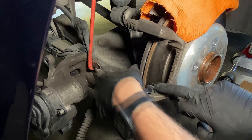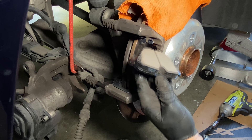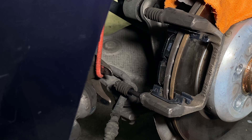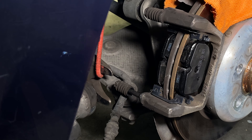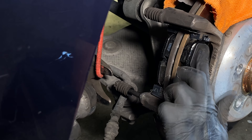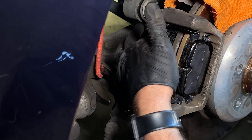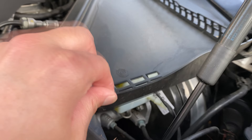I'm purposely showing you a lot of this — some people might cut it out, but I want you to be able to see how things go on and off without rushing, because the first time you do this it's just easier to watch someone else do it. There's your new brake pad — it takes a little finesse to get it in, so try several ways and angles and eventually it'll slide right in. There's one in the front and one in the back. It's important to know that these are specific — the one on the inside should have a larger opening for the brake pad sensor. I did mess it up and put the wrong one in the back, so I had to swap it. The kit comes with grease, so you'll want to grease the outsides of the pads, not the insides — that will reduce brake squeal. Be clean about how you do it and only apply it on the exterior of the brake pads.